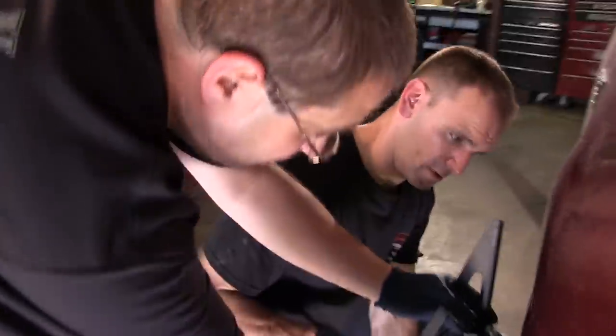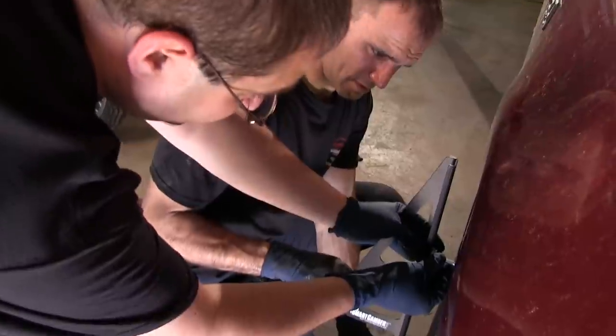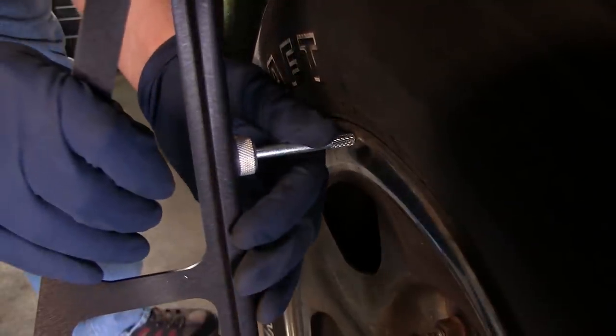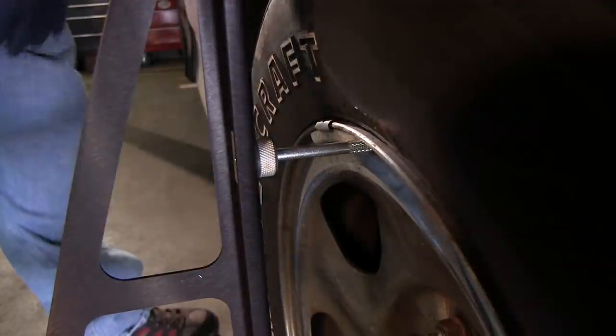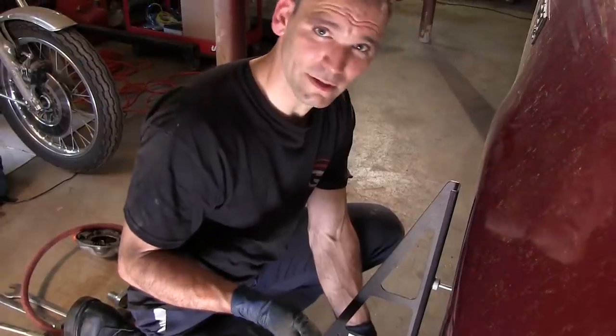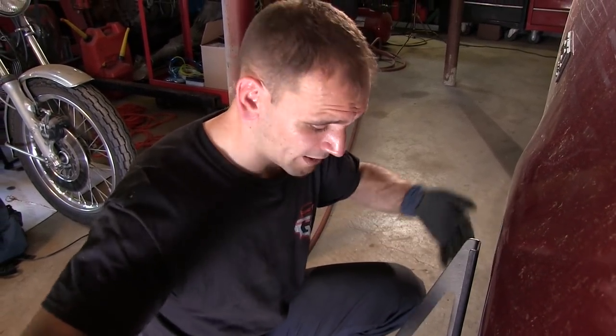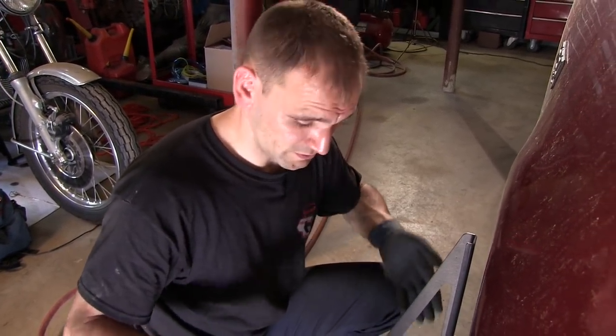All right. If you bring this top pin up just above the edge, the lip of the rim, and you can just put a little tension on it. And just lock it right in there like that. That's perfect. That works really well. And now it's locked in. I can make my adjustments on the inside. As long as I don't knock into it, it's going to stay where it is. It's going to give me a consistent reading, and it'll allow me to set my caster.